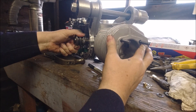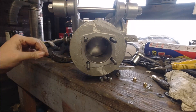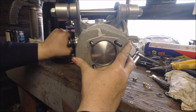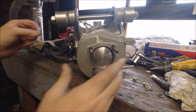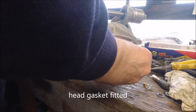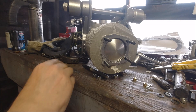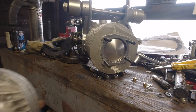Right — just bring the piston up the barrel, barrel back in, and spin it around towards us a bit more. Because this is the first time the rings have been on, just take your time pushing it up and down the barrel. That's the thin one on, and then we need our head. Spark plug to the top — which you should know if you've done any engines before. On some of the racing engines it can be centre.